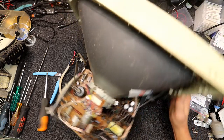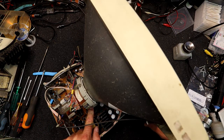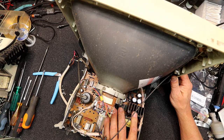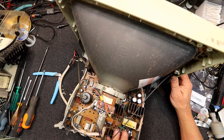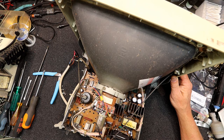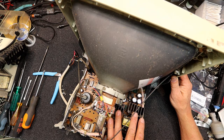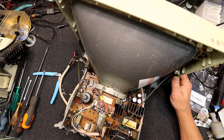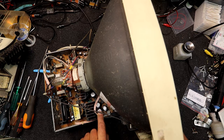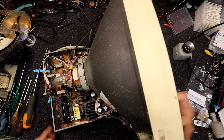We've got these heat sinks — I think that is all power supply. The horizontal output is over here with some quite large diodes in TO220 flat pack cases. That would be to run both the monitor itself — being a monochrome, it probably runs off 12 volts anyway — and the floppy drives and the computer. There'll be one or two of these diodes running big 5-volt rails. The filter caps: 3300 mic 16-volt cap, and another 3300 35-volt.